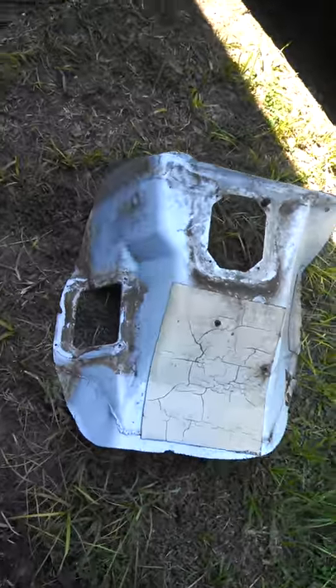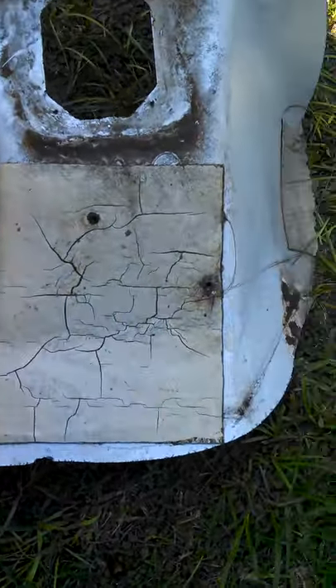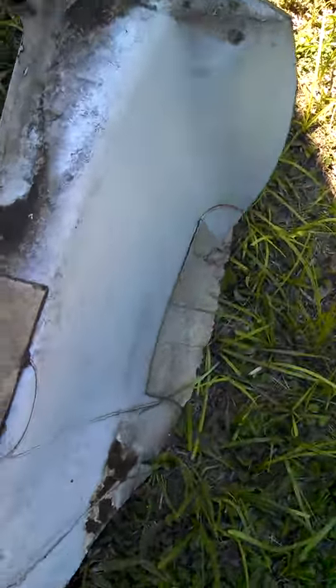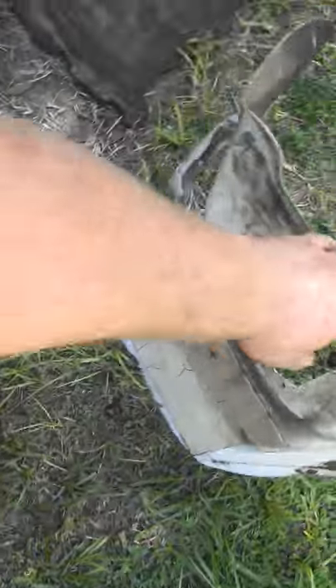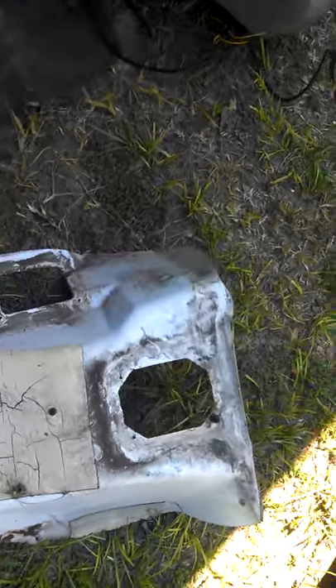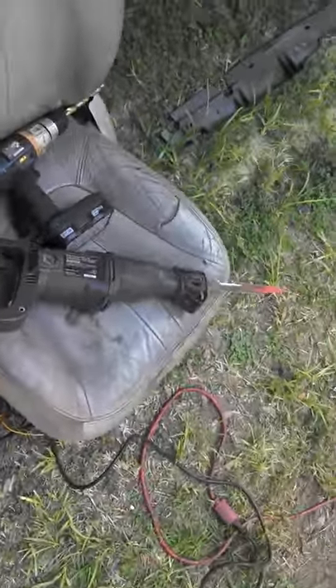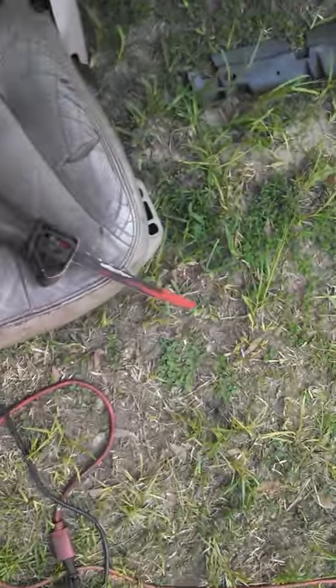The cuts don't look very pretty but it'll work. Just drilled a hole and put a sawzall around the whole daggum thing. But I got my floor hump, so that ought to make things pretty easy rather than having to fab one. A lot of guys out there fab them when they do this. Just a regular sawzall — I went around it and flipped the blade upside down when I went across the top of the hump. And it came out pretty easy.